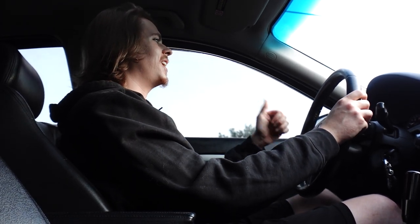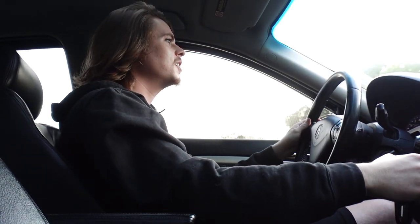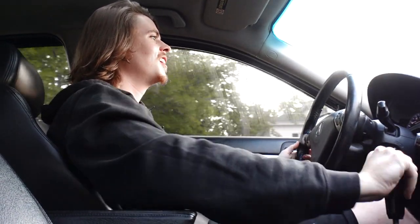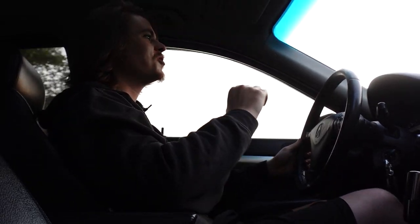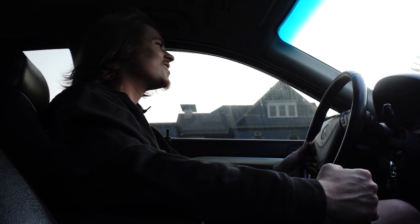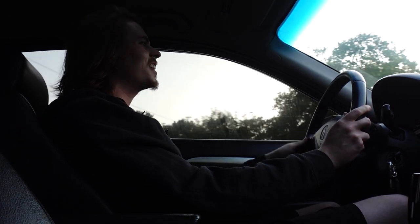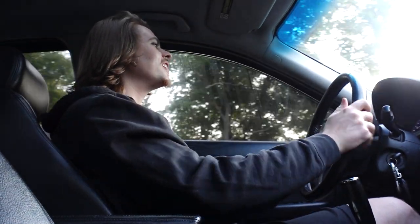We're going to go for a ride and try to get this thing up to speed. We took about half of our acceleration wobble out of first and second gear which is awesome, and it's not tracking around the road anymore which was really the thing I wanted to fix. Feels like the ball joint or something like that is starting to go, but the biggest issue was the control arm. I just hit a good bump and barely felt it. The shifting is better too - this car is so much smoother now!